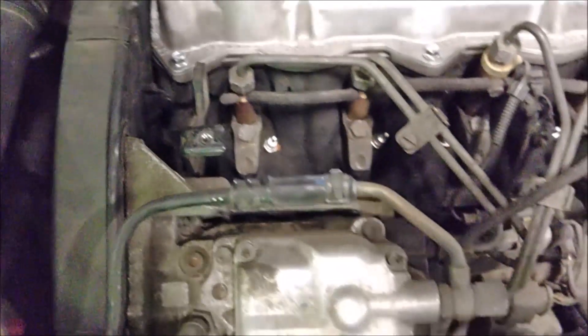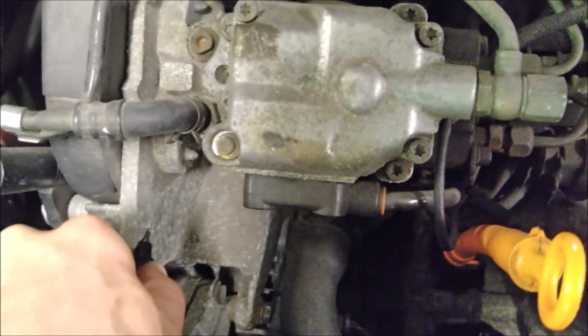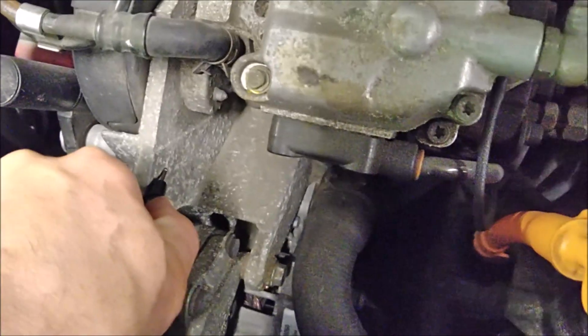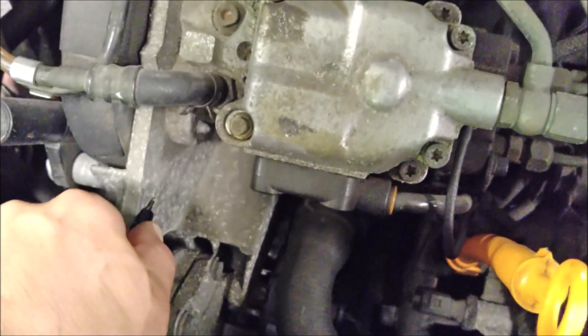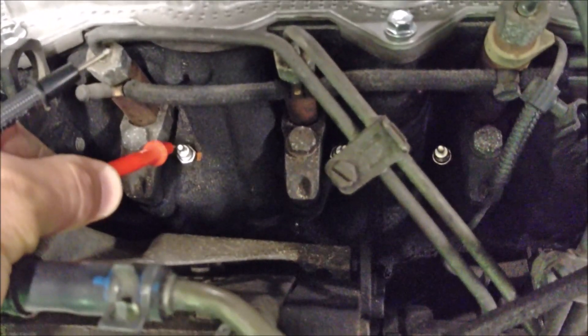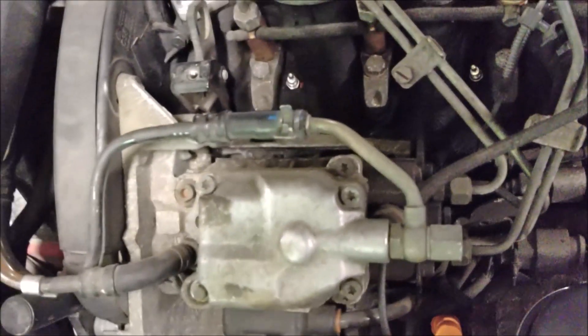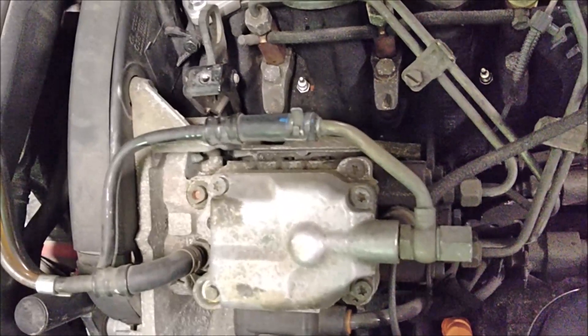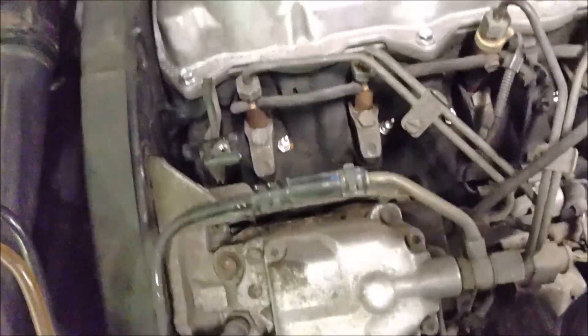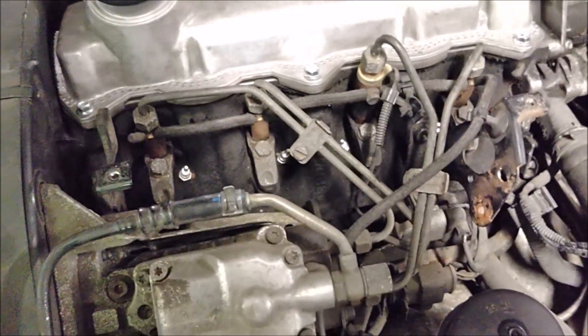What you need to do is touch one probe to the glow plug and the other end to a good ground area. I like to use a clean spot. Hold this here with one hand and then put your other probe right on top of the glow plug itself. These should all be around one ohm, plus or minus 0.1 or 0.2. If you get a really high reading, you've got a bad glow plug. So we're going to test each one.